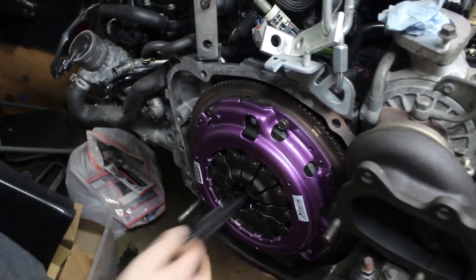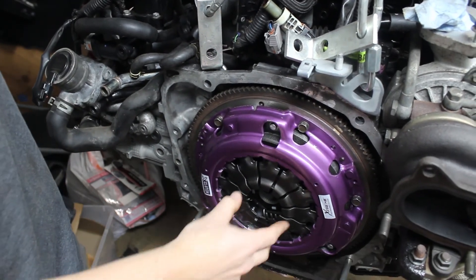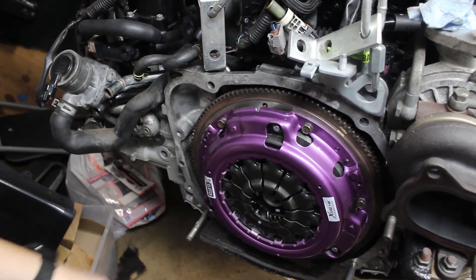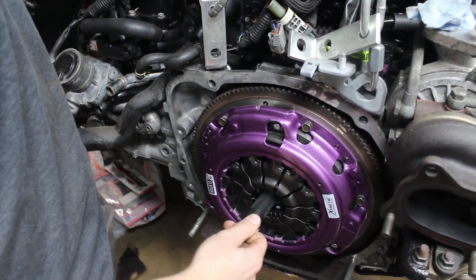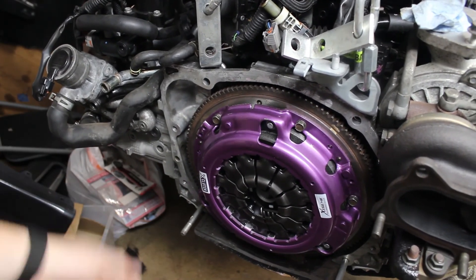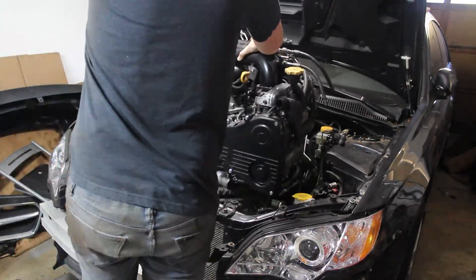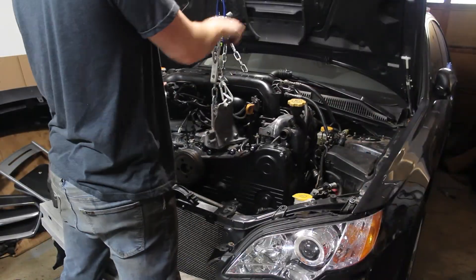Notice how this one doesn't have any groove inside here — because it's a push-type clutch, and the throw-out bearing simply pushes on the fingers to disengage the clutch. It bolts up and works okay. I was able to reuse the old pilot bearing because it was the same from the other clutch kit, and it's lined up the best I can. I'm going to pop the throw-out bearing in the transmission and then we can try and drop the motor in. The clutch is on, the engine is on the hoist, and I'm basically ready to install the engine. The next part, the engine will be going back in and we'll be getting it all hooked up. As always, thanks for watching, and feel free to like and subscribe.